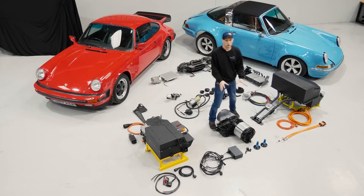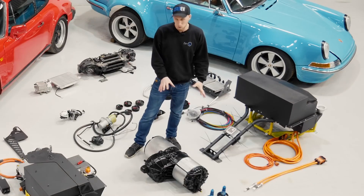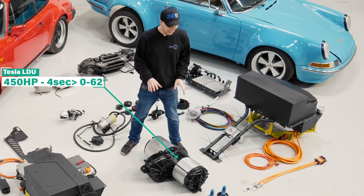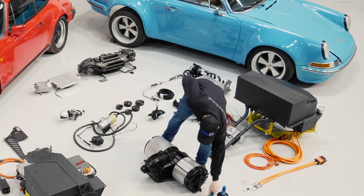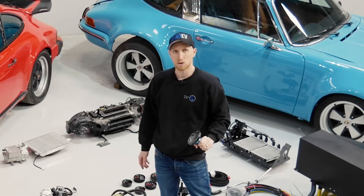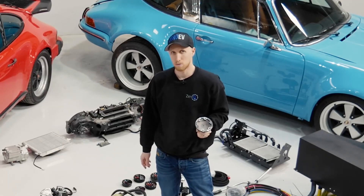We then have a large Tesla drive unit — of course we were going to have a Tesla drive unit. We've set the Porsche up to be about 450 brake horsepower in just over four seconds, zero to 60. This is a complete bolt-in to the original set of manual drive shafts. We have forged 108 joints straight into the Tesla drive unit, straight onto original Porsche shafts — nice and easy, no custom shafts needed.